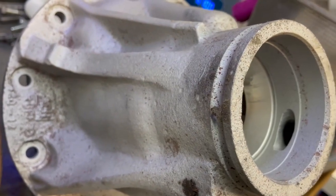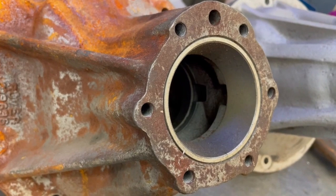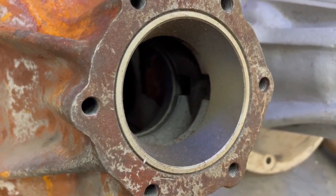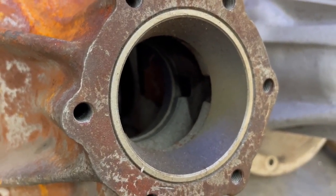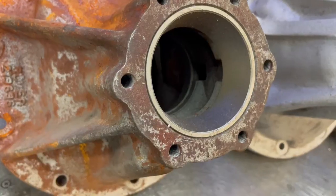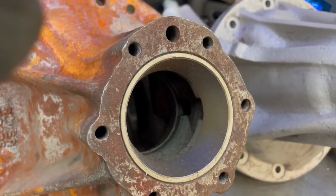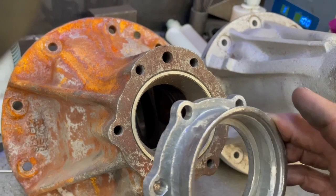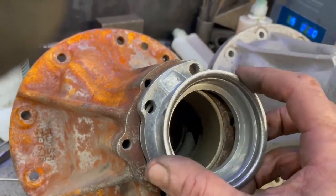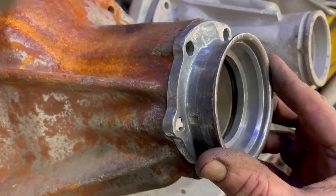Here is a metric 539-707 tail bearing — a one-piece casing. We have very few of these left. This is a 1950s big-bearing case, and that bearing at the front is absolutely massive compared to the standard one. This front piece gets bolted on where your seal sits inside, and it's unbolted — so if you ever need to change your pinion seal, it's a very straightforward job.